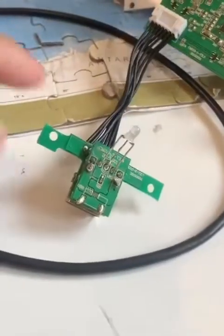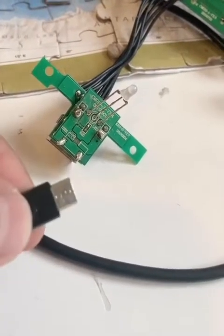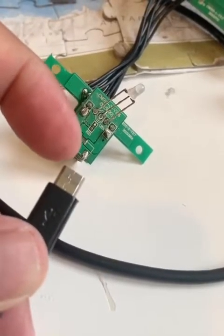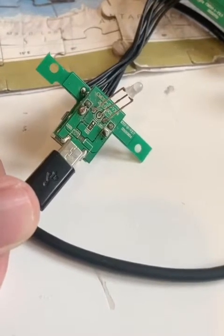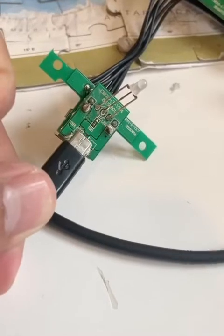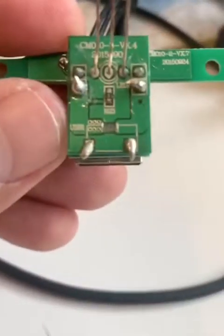The problem is the original charging port was here, but it has been pushed through because I mistakenly used the wrong cable. I thought every mini USB was the same, but the thing is some of them are longer. So if you are replacing yours, you have to get the right size — otherwise it might damage your charging port. When you push it in, it pushes the port from inside and takes it off, which is a hell of a problem to replace.